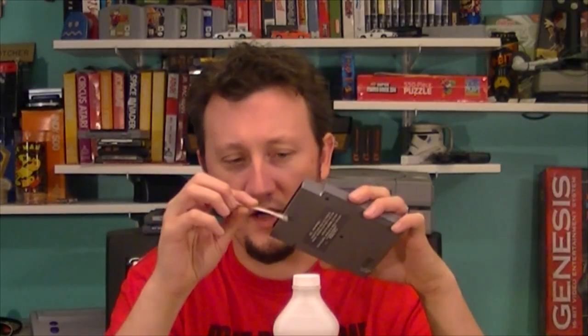The real problem is that your game is dirty. And there are two approaches that I like to take when I encounter a dirty game. First, grab yourself some isopropyl and a cotton swab. Get your cotton swab wet with some of the isopropyl and rub the contacts back and forth, top and bottom. If your game isn't that dirty, this is all it will take to get you playing.